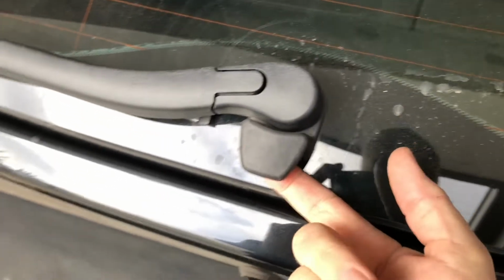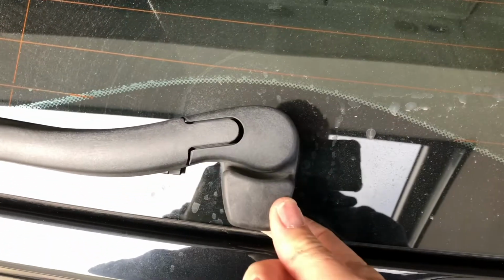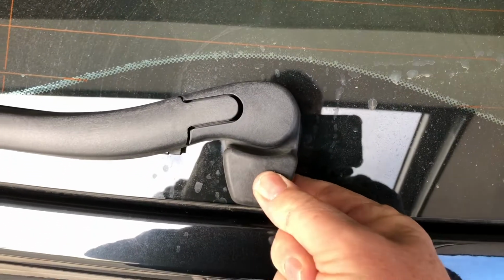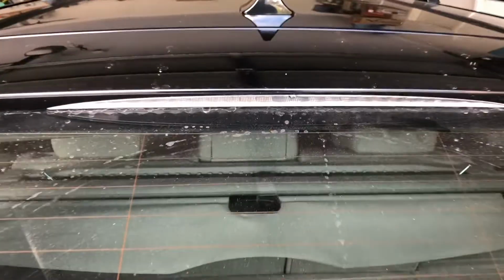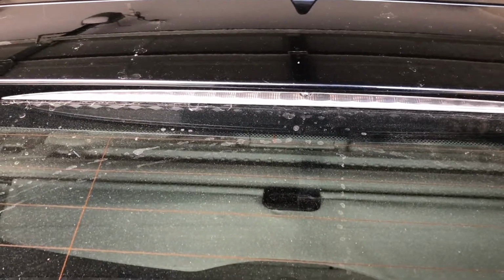Now, with the hinge, the boot lid popping open, which is what I've got, you do have a micro switch here. So there's a switch for the opening and closing of this, right there. Give it a press, and it opens. We've also got a brake light here, so that's what I'm thinking is going on, because mine pops open when I put the foot on the brake always, so I'm thinking there's a joining in the wire.